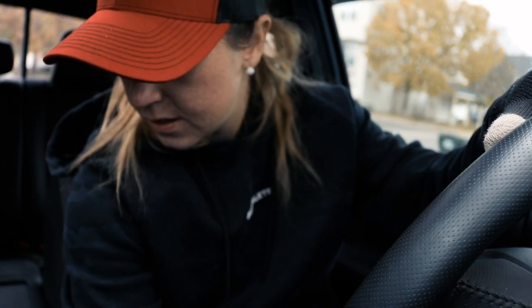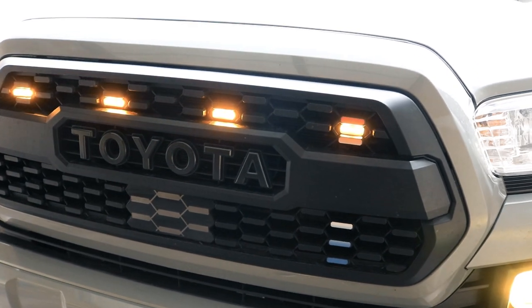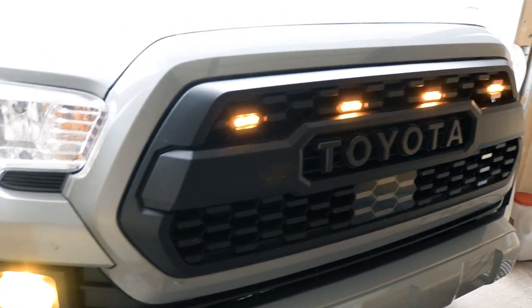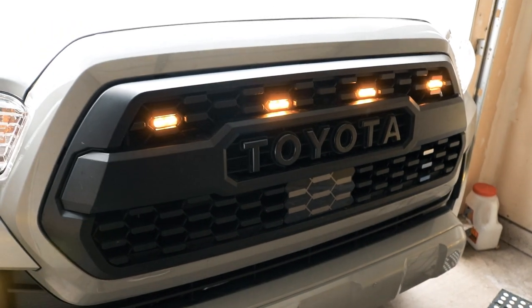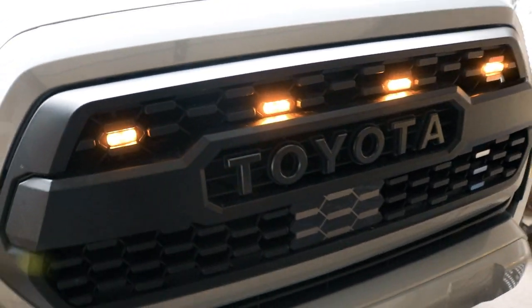Oh wow, it is cold. So now when I turn my truck on, the Raptor lights come on — which is exactly what I want. And there we have it, they are working. Successful install! Tell me guys what you think — do you like it better all the way across the grille or the way I had it before? I see pictures and change my mind all the time, but I'll keep it like this for now. It's super easy to change. That is going to be the install video. Fairly simple — the hardest part was just feeding that fuse through the small gap. I apologize, it's hard to film in the fuse box; there's a lot going on in there.